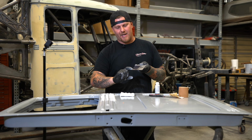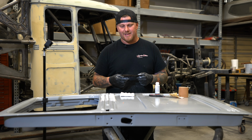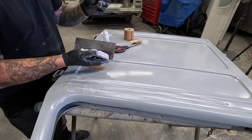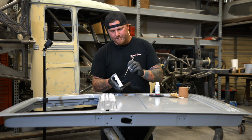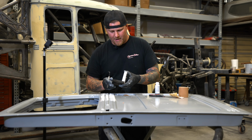So if you pretend this thing is 3/4 to 1 inch thick that you're gonna use for the hammer portion to make those dies, this is exactly how you're gonna get that profile. You are then going to clamp or push that down to the steel, and we're going to be using a very sharp scribe to then mark exactly where that profile lands on the Dykem.